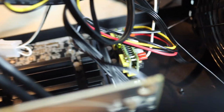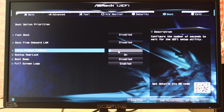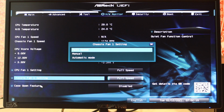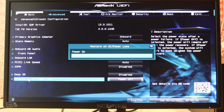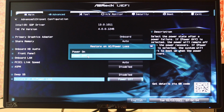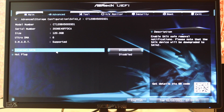And once we go into the boot menu, you'll want to configure a couple things in the BIOS. Number one, if you're going to be booting a couple times just to figure things out and play around, you might want to extend the time that the boot screen originally lasts. So instead of like 1 or 2 seconds, make sure it says like 5 to 20 seconds. You're also going to want to make sure that your internal graphics card is not the primary. And then you can make sure that your PCI slot is set to Gen 2, Gen 1, or Auto as the speed. You can page through the different menus and just take a look at the options there, but those are some of the main ones, and I go through that again also in the ebook and just outline it in greater detail.